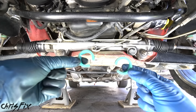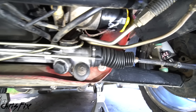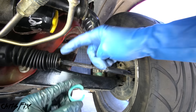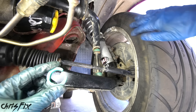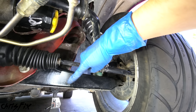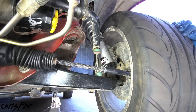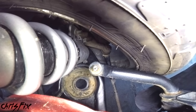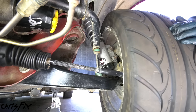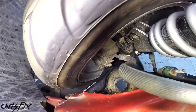Before dropping the car to the ground, go over to the wheels and check for steering clearance — this is a step you can't skip. There's a reason rack limiters exist: usually the wheel will make contact with the sway bar or the control arm. If you do make contact with any suspension pieces, don't worry — there's a solution. Turn the wheel to check, and as it turns out we are making contact with our sway bar. Turning the other way, there's plenty of room in that direction.